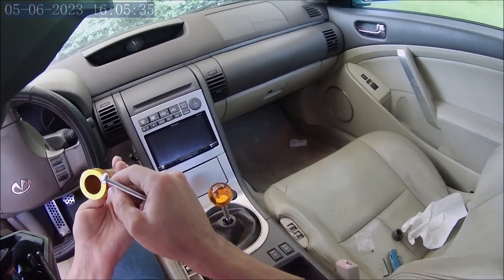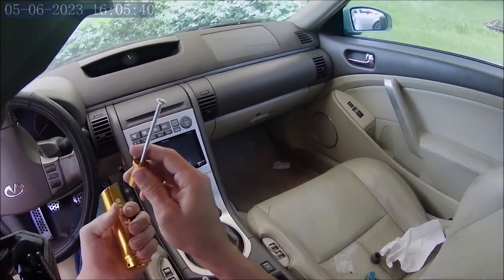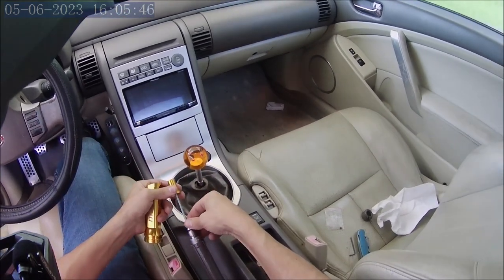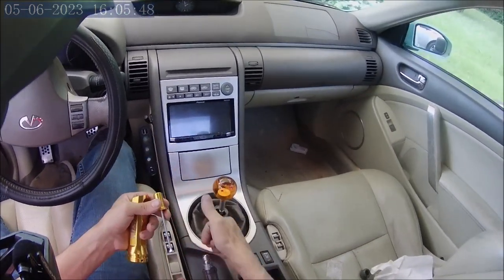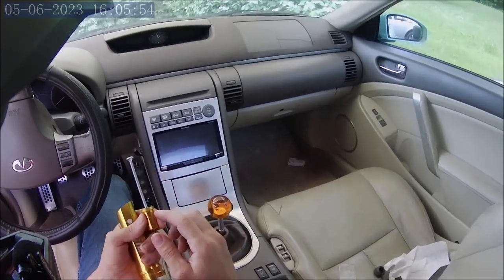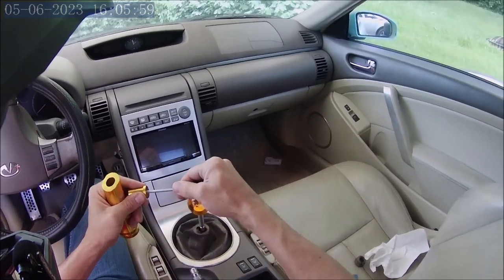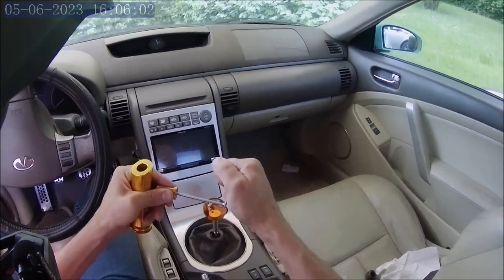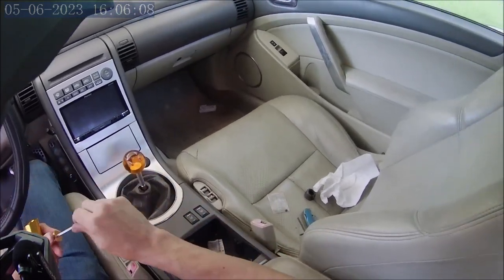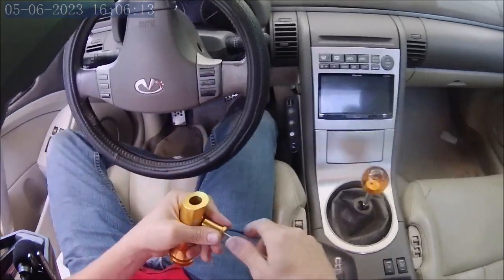So you can see you got three set screws in here, and this is a carriage bolt, and this is a threaded hole. It comes with that threaded hole in the button, and this is so that you can extend this button down, and it will push this, so it still works as a factory e-brake. The threads are 10-32, but this is actually a 10-24 carriage bolt, and I did that on purpose so that as you turn it in, it'll start threading, but then it immediately jams itself and locks, so it won't unthread. It's actually on there and going nowhere.